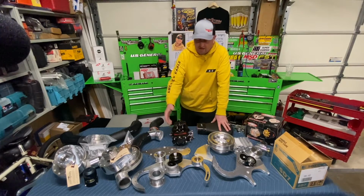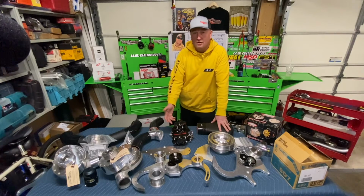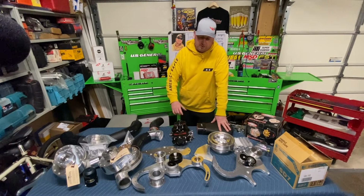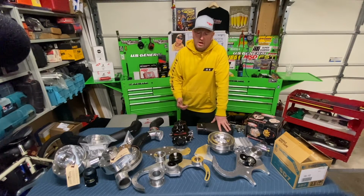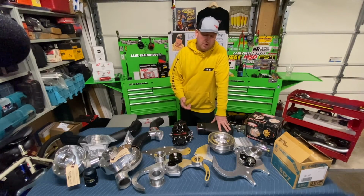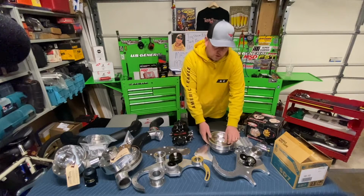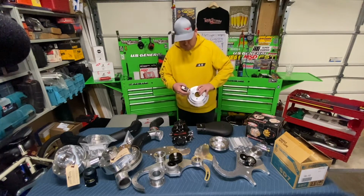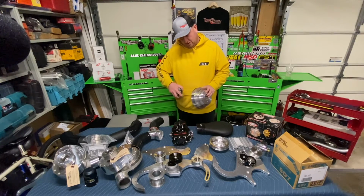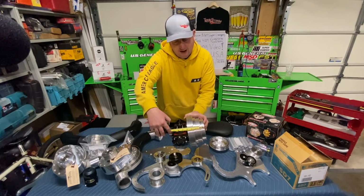So between the intake, you have to consider all the heights and all the different dimensions that you have to work with. I have some room on my core support because I already know that I need 3 3/4 inches from the face of the damper clear to the face of the drive belt on this pulley, right? So that kind of gives you, it's right about there. So there's your 3 3/4. You can kind of see it's backwards, but there it is.